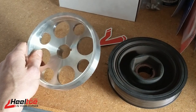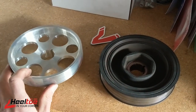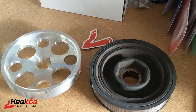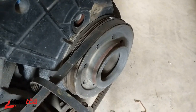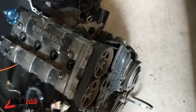We've been selling these pulleys for over 10 years. I've had a lightweight underdrive pulley on my actual TSX for over 10 years — I've done oil sample testing, taken it to track days, daily driving, long distance commutes, and driven from Portland to LA at least three or four times non-stop without any issue. Also worth noting: not every crankshaft comes from the factory with a rubber damper. Look at this 89 Integra or first-generation CRX — the factory crank pulley doesn't have a damper at all. Many engines actually don't have harmonic dampers, and our contention is that these Honda engines are well enough designed that they don't suffer from those detrimental factors.